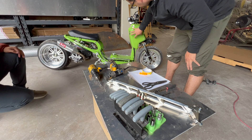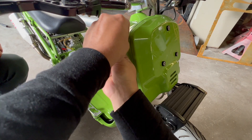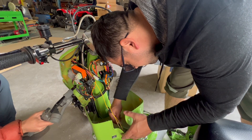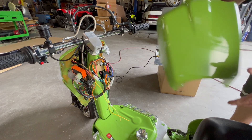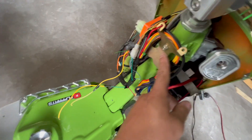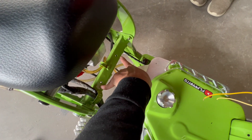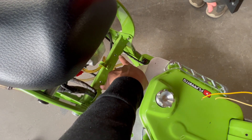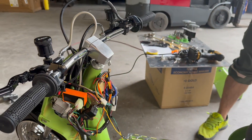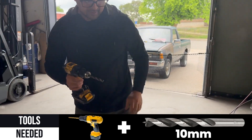First thing, put that back on your magic bench. We're going to move the battery box. These little tiny screws — like glasses screws. All right, you made it this far, you took off the battery box, you're going to graduate to the next level. So just to show you some of the mounting points we're going to be using: this guy right here and these two holes — one there, one there. We're going to drill them out with a 10-millimeter drill bit, mount our back brace, then mount our top brace. Then we'll get to the real naughty stuff when we start drilling into the battery box. 10-millimeter drill bit — let's drill some holes.